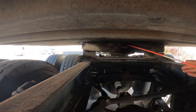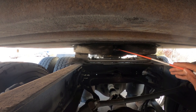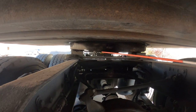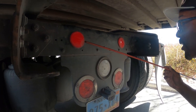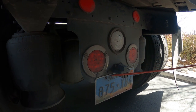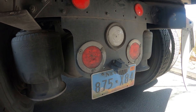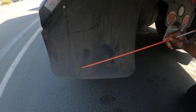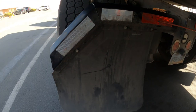I have my king pin — properly mounted and secure, straight, not bent, not broken, not cracked, and it's locked around the shank of the king pin. I have my red reflectors — properly mounted and secure, clean, and not cracked. Back here I have my brake lights, tail lights, blinkers, and four-ways — red in color, properly mounted and secure, no cracks, no condensation. My mud flap is properly mounted and secure, not torn or frayed, no more than six inches from the ground. My DOT reflector tape is clean and present.